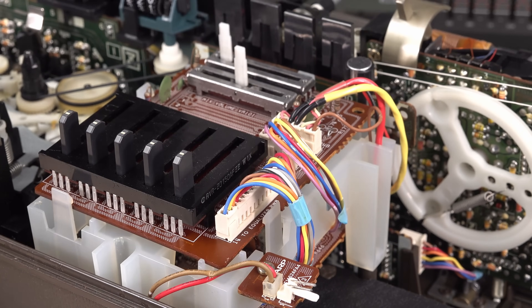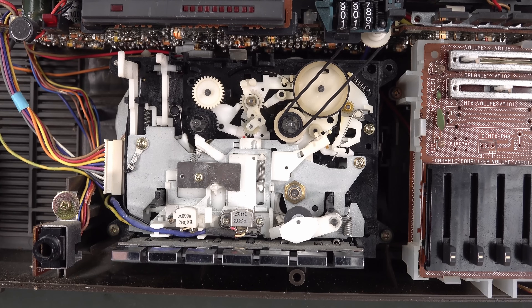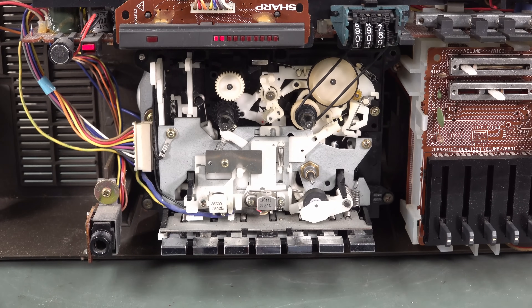There's our tape transport mechanism, and that looks very clean. This whole thing is incredibly clean — there's a little bit of dust in there, but jeez, you can't complain at all. The heads are great, the capstan's fine, the belts look okay, and as I said, this thing actually plays. All the springs look good. This looks in very good nick — it doesn't really need a service at all. All right, let's turn this bad boy on. VU meter! We have a cassette: Smash Hits 1987.